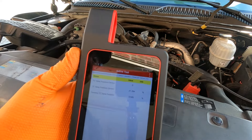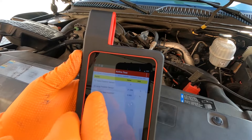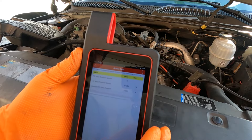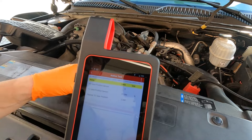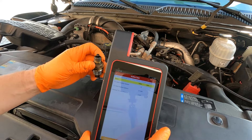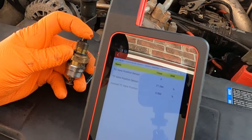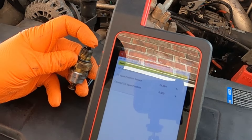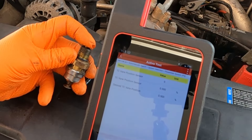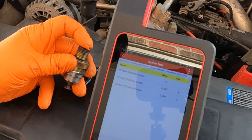Here's what we've got. The top reading says turbocharger vane position sensor desired is at zero, and the actual turbocharger vane position sensor is at 21%. So right now it's desired to show zero, and the actual is delivering 21% of its movement range. Watch what happens when I put my finger on here and push it down — I can make that go down to basically zero, pushing that little tip all the way in. But when it comes out, it only goes back up to 21%.